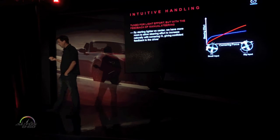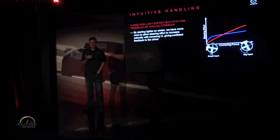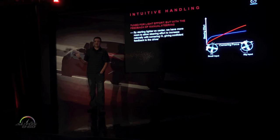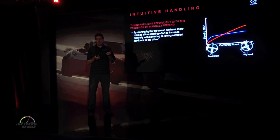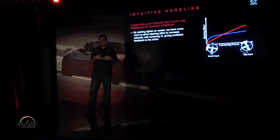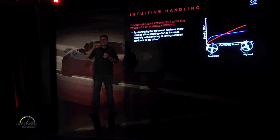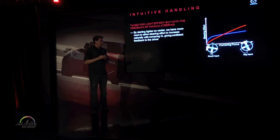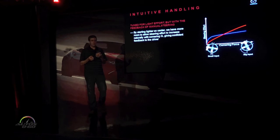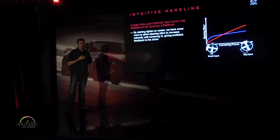In tuning this steering, it's very much the same strategy we use on all our EPS cars — trying to get a lot of steering feedback, a lot of buildup in relation to corner energy. We want the feedback of a manual steering car without the absurd effort. In order to have the effort build up in proportion to cornering G, we have to start out at a much lower level on center. Our old hydraulic systems tend to have a lot of buildup right around center and a strong self-centering feel. If you add all this effort around center, you can't keep adding effort or it'll get too heavy at high G. So we keep the effort on center very light and nimble around town, and as you go deeper into a corner you feel very honest feedback about what the tires are doing — giving you confidence to understand and drive to the limits.